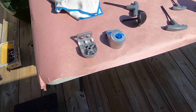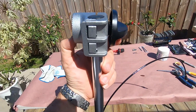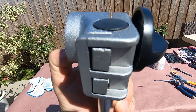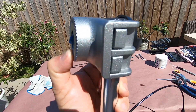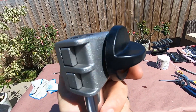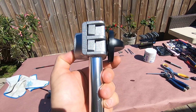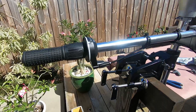It's very important to get the tube on an angle and slide it into position, as it will be adjusted once it's on the kayak. This always gives people trouble: when putting the tiller arm through the clamp, you want to make sure it's slightly opened up. I usually hold it between my legs, open the clamp, and slide the tiller arm right through. Then grease your spring, put in your clamp the right way — I always face mine upwards.